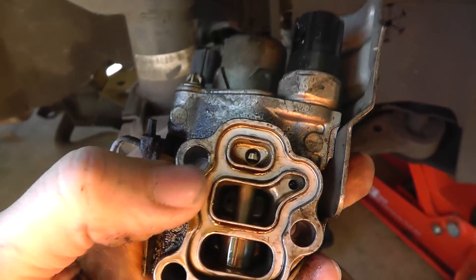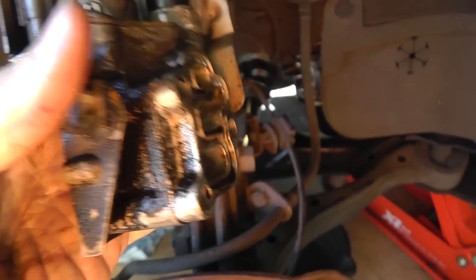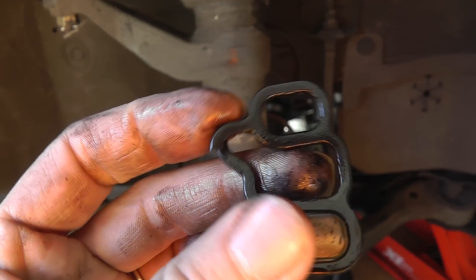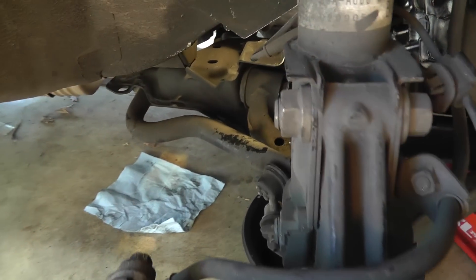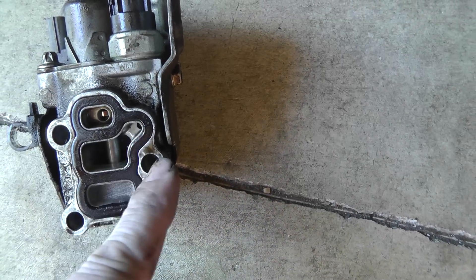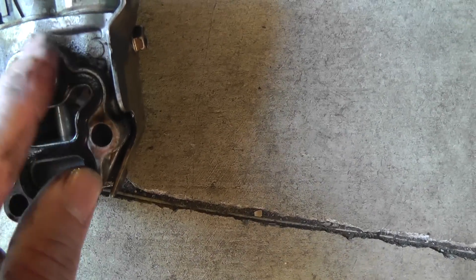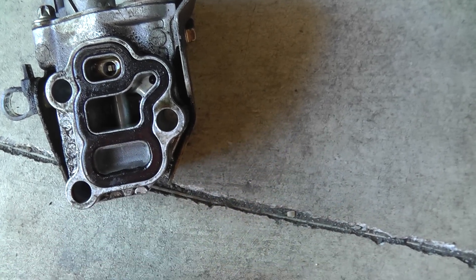Behind this apparatus there is a little gasket that goes right in here. Now, you can just go ahead and buy the gasket, but this is where my oil leak was coming from. What happens over time is these gaskets tend to get really flat and hard — this thing is hard, it's not even pliable, it's real brittle. As soon as I touched it, it broke apart. The gasket is compressed up against that engine for so long that it begins to lose its seal. It's almost flushed up against the metal, and the leak was coming out from the bottom of this the whole time.